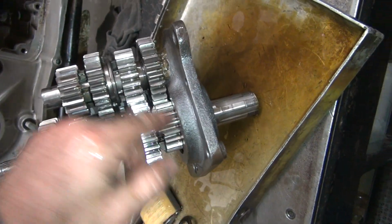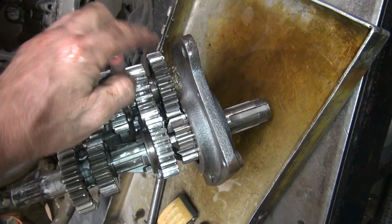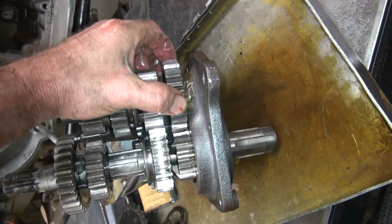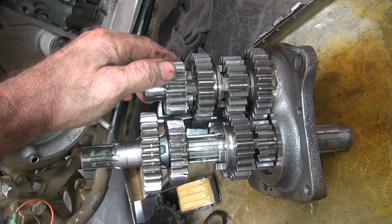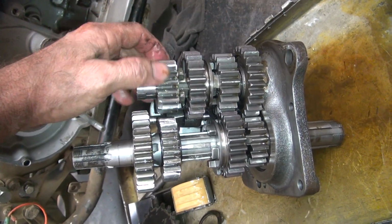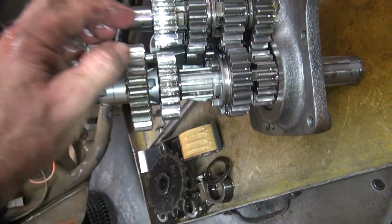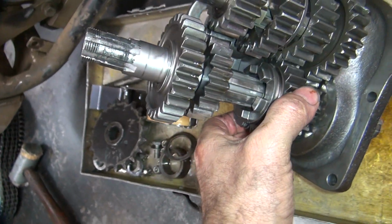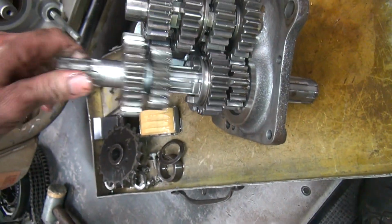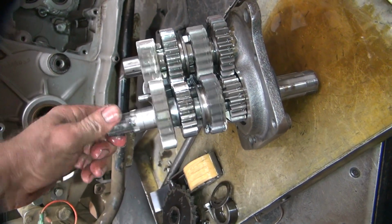So that's a close ratio. High gear, 18 tooth, 26 tooth. So that failed. This is a late model low gear. Still feels all right, but the gear next to it does not look the best. Oh, that's second gear. Duh. Or no, that's third. That's why it doesn't look the best. There we go. I'm going to get down there and see if there's anything noticeable.